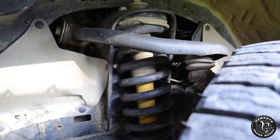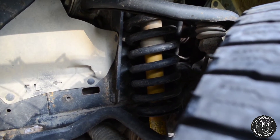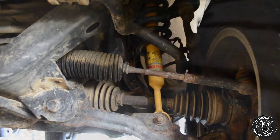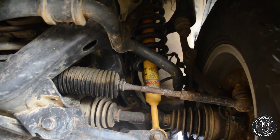There's no sense in doing it right now. Front suspension was great — no problems with flex. I did a couple times feel like maybe those springs are a little bit bouncy. Based on my research I feel it's the spring, not the strut. It's a little bit bouncier coming down off stuff, even slowly, and coming off small things — a little bit bouncier than I would have liked. I'll probably keep my eyes out for sales on used struts or used springs and go to 5100s like everyone else.